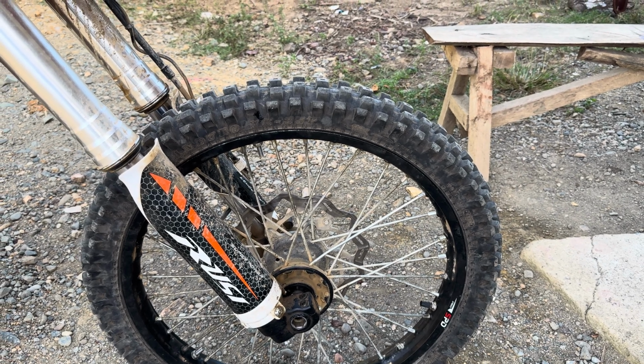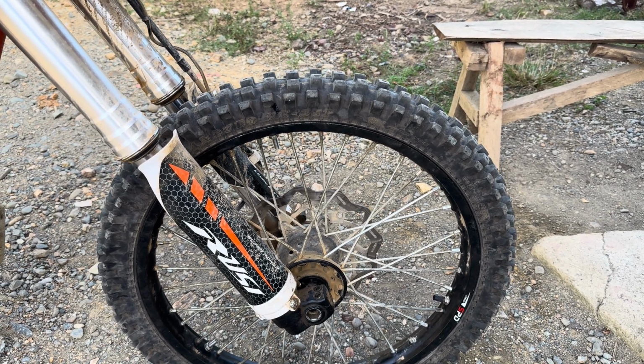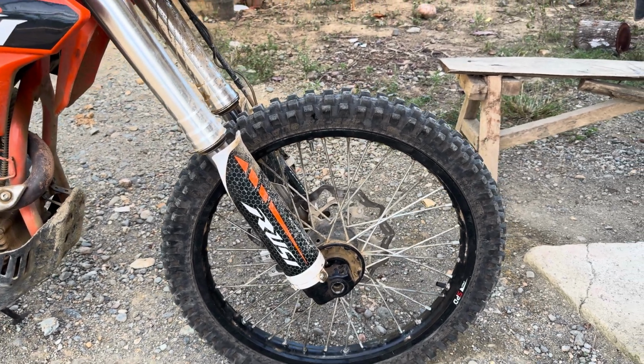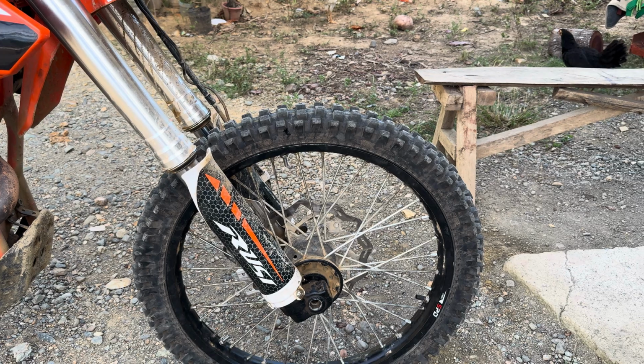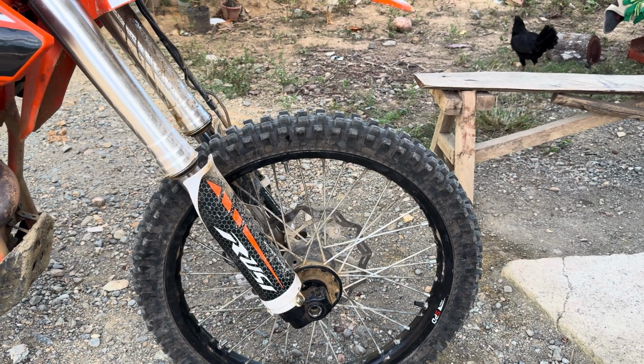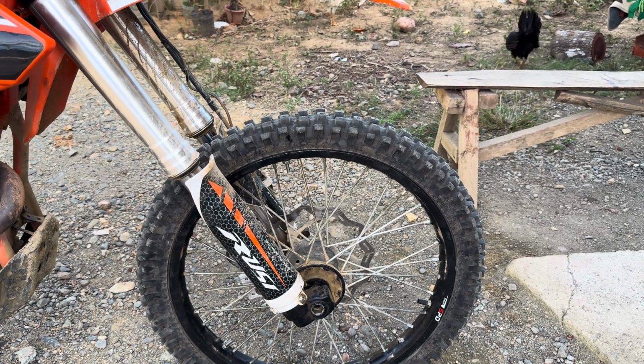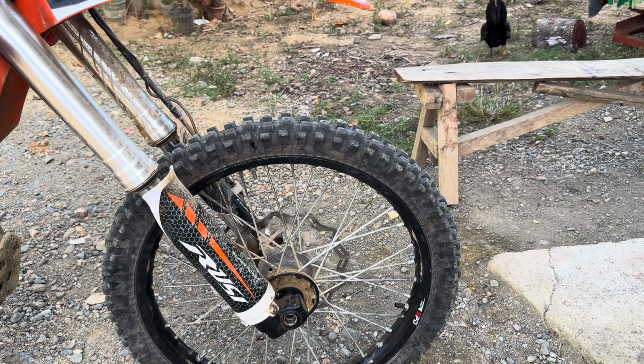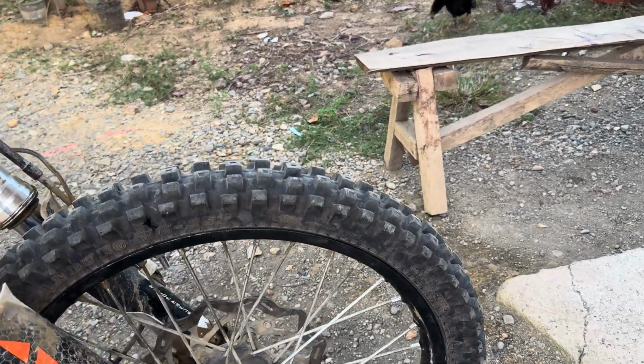Yeah, I think it was like 7.8 or 9 or something. So I said, let's just do an 8mm thing. So that's new. Wrote on it. And if you don't know what rim locks are, they lock the bead on so you can run different pressures, and the tire and rim won't spin separately.